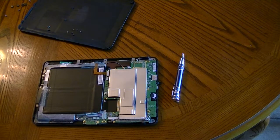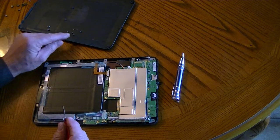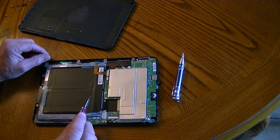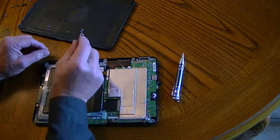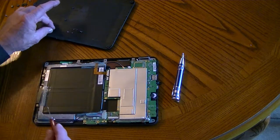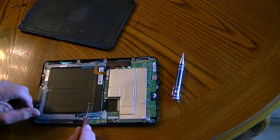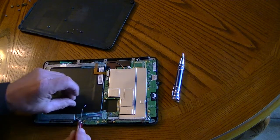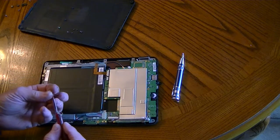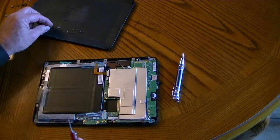Back again with more of the disassembly of the G-Tab. I've taken out six of these tiny little screws around the outer edges, and then two a little bit larger up here on the end. One goes into the plastic and has a wood thread, and this one has a machine thread and goes right in the very end — it's a little bit longer and a little bit larger.